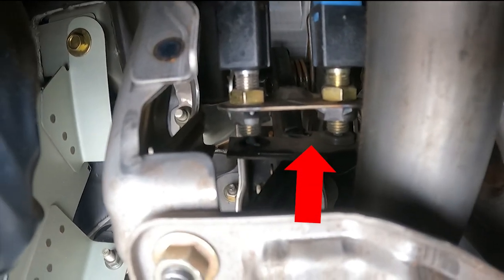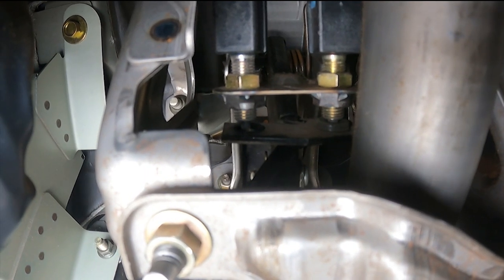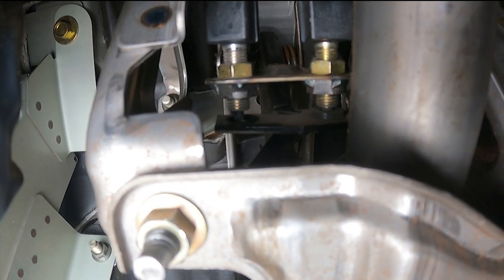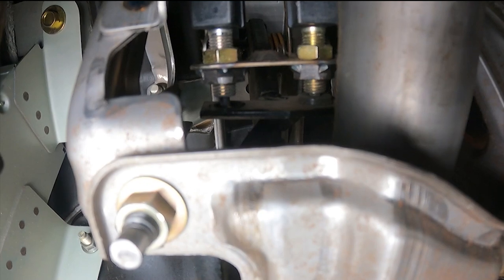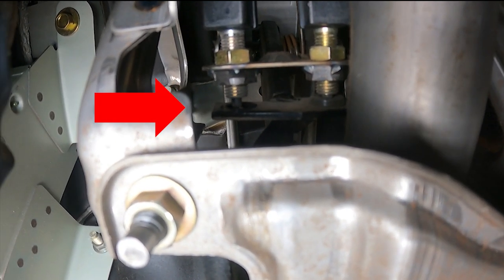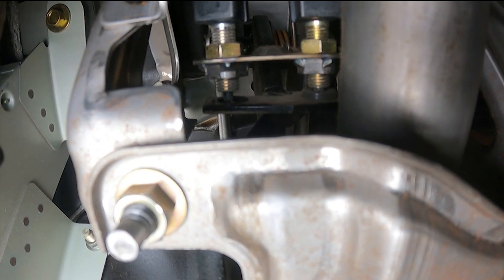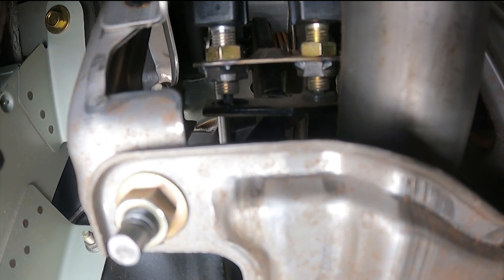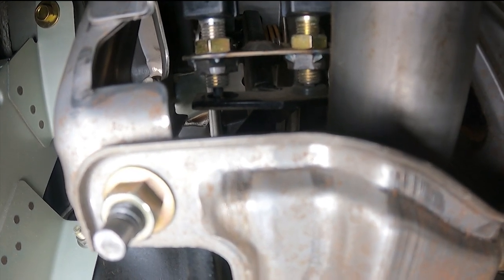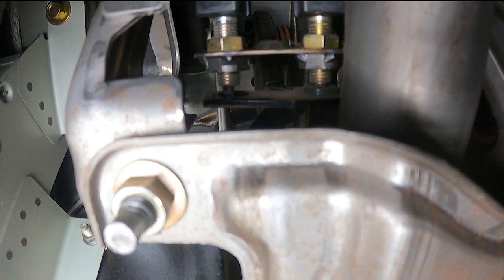Here you're looking at the brake plate that pushes on the switch. You can see the two switches — the one on the left is the clutch switch, the one on the right is the brake switch. You can see the brake switch still has its little grommet in place, but where the clutch switch is, there's a hole there — and that's what's causing our problem. So we're going to replace both grommets: we'll punch out the one that's on the brake, then put both brand new ones back into those locations. That gives you an idea of where we're working and the kind of little space we have to work in.